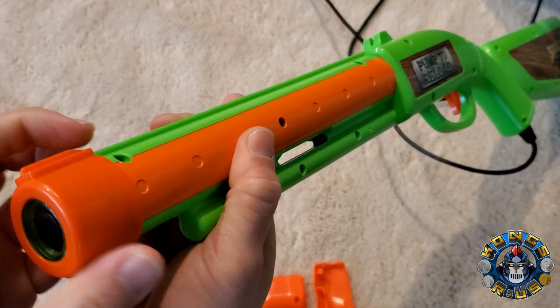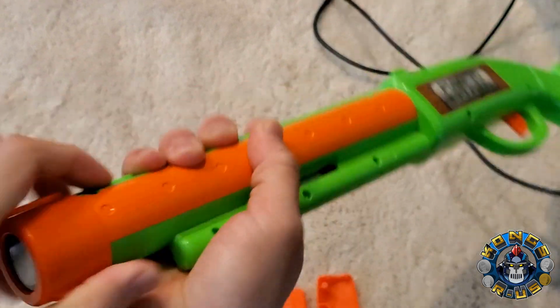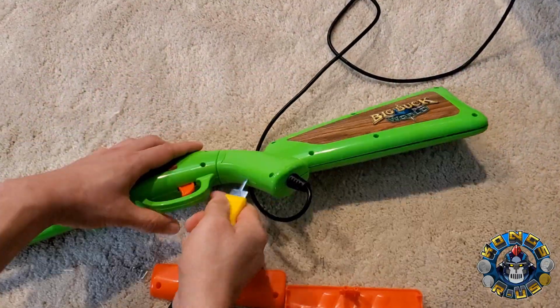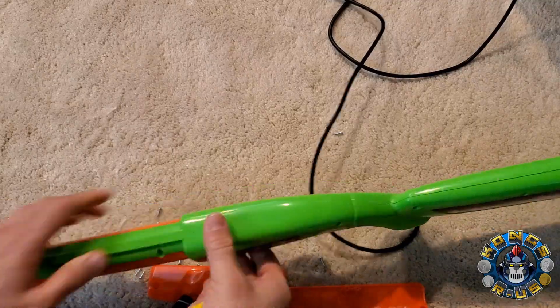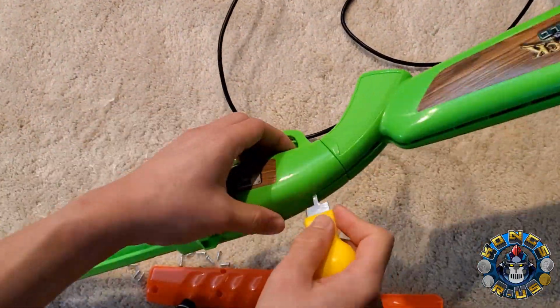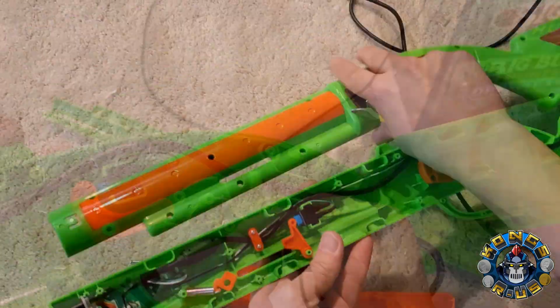But with my green gun, I started by trying to wiggle the cap back and forth, and was eventually able to twist and pull off the cap, so I highly recommend doing this first. Once you remove the screws and cap, you can slowly start to pull apart the two gun halves. I recommend using a watch knife or something small and flat that you can use to pry the sections of the gun apart slowly. There are some areas that are still glued, so be cautious.